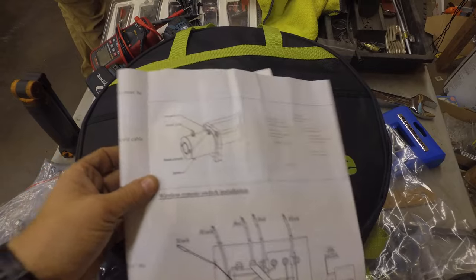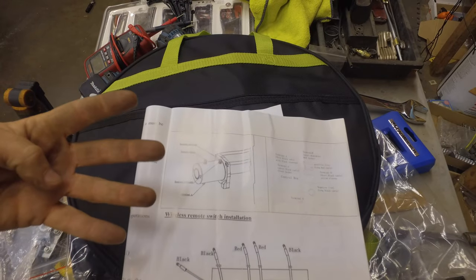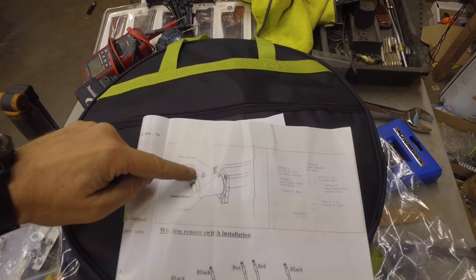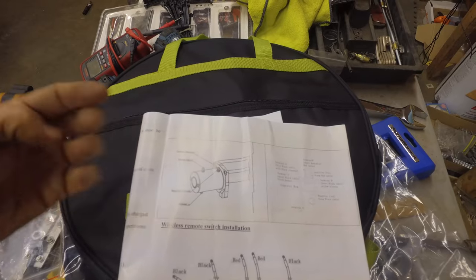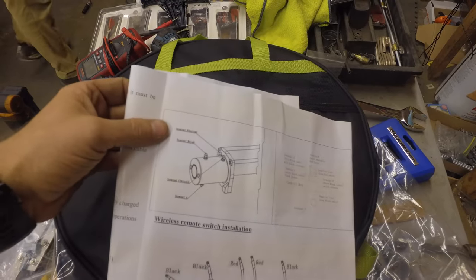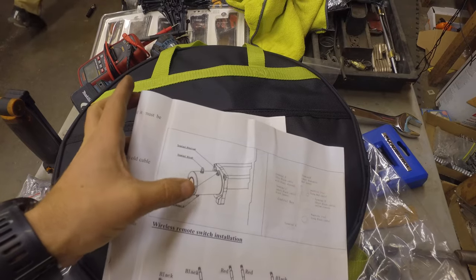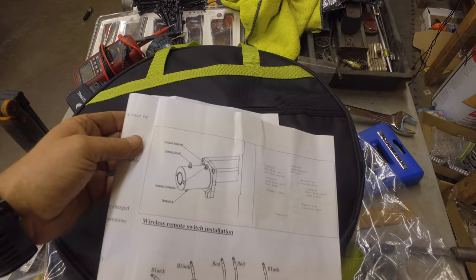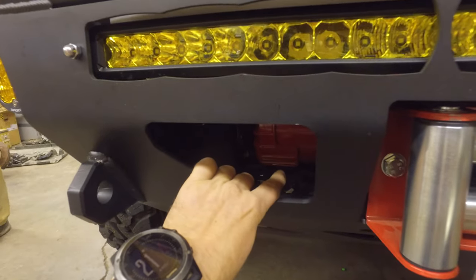We actually wired it a little incorrect, so let me clarify. From the control box there are four wires coming out: yellow, red, black, and a thin control wire. We did hook those up to the three terminals on top and connected the little black control wire to the ground — that was a mistake. You actually hook it down to the bottom one, which is terminal A. So we had to reconnect the ground wire for the body and the small control wire down there to terminal A, which we were able to do with everything still on.